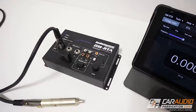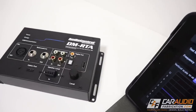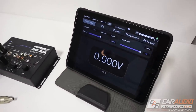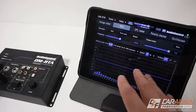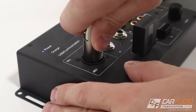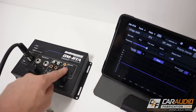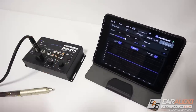I want to show you a cool test tool from show sponsor Audio Control. This is the new Audio Control DMRTA, and this is many tools built into one. We can connect to it with a computer, or connect via Bluetooth using the ACBT24 and a mobile device. We can connect to the speaker wires of an OEM vehicle and measure the voltage, see the signal response coming out of an OEM or aftermarket amplifier, connect to a microphone and measure the audio signal on the RTA graph, use it as an SPL meter, and it has a built-in polarity checker and oscilloscope to check for clipping. There's really a ton to go into about how to use the DMRTA — I'll be covering that in an upcoming video. In the meantime, you can check out details about this device down in the video description.